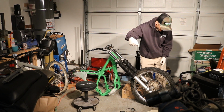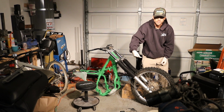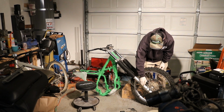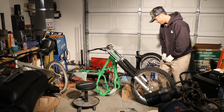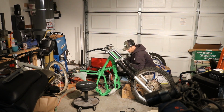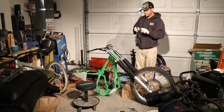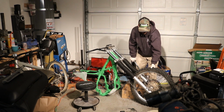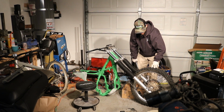The axle inserts from right to left, so passenger side in the United States to driver side, because there's this little spot on the fork that this rides on as you tighten the axle. And in case you want to know, the axle nut is a 19 millimeter. And I will put a cotter key in to hold that in a little bit.